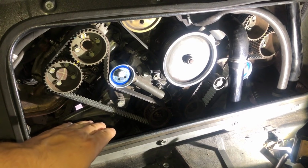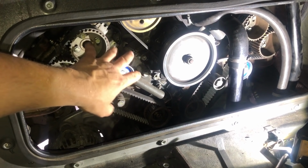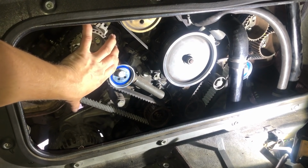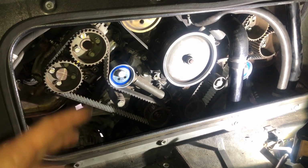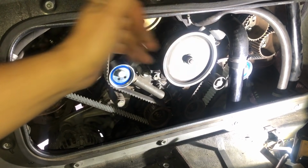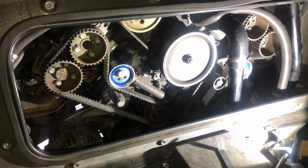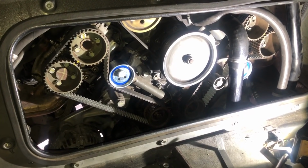So the higher the frequency, the tighter the belt. Obviously, if I'm over the 220, I would need to loosen off my tensioner and just loosen off the tension on the belt. And that is it. That's how it works. Hopefully that explains it. It's simple enough. It's the same process on the power steering belt, the alternator belt, the water pump, everything like that is the same way you tension up the belts on the 360 during the service. So it's all done with a frequency reader. Okay, so any questions, give me a comment below and I'll try and answer them.